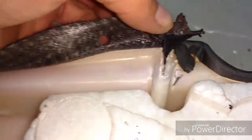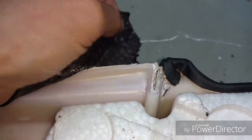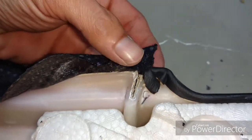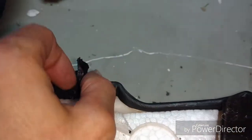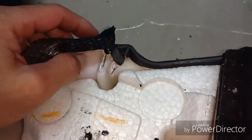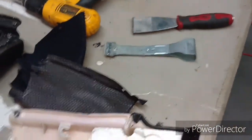Here's the cut and you can see the flap that's in there. You'll come up to this point, have your excess of flap, it'll fold together and pinch, and then you're able to pull that back through so you can glue it the same way they did. The fabric absolutely has to be pulled through here in order to achieve the look without wrinkles — that's why the slit is there.